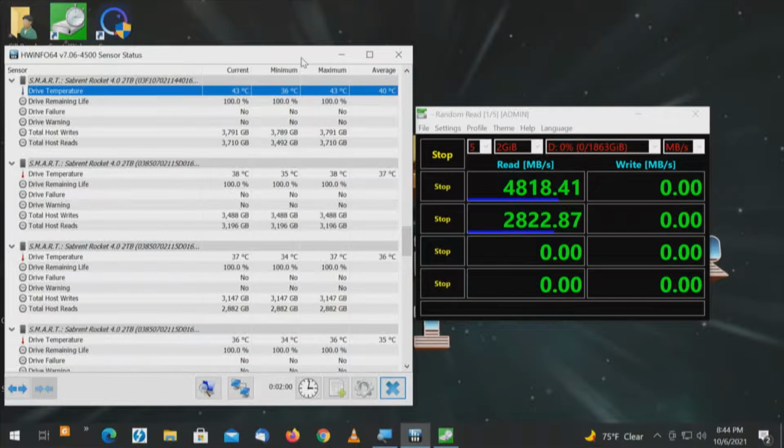And I had no idea we'd be doing as much of this as we are. I'm curious to see how this is going to compare to the Asus. Even though they're both quad cards, and even though they both require a 16-lane slot, it's interesting the approach that Asus has taken, and they are in their 3rd iteration of quad card, whereas Gigabyte with the Aorus has chosen a little bit different direction, and this is their first card. It's impressive. So we established these are PCI Express 4.0 first generation drives. We're just under the 5,000 megabytes on the read.